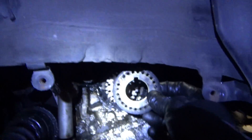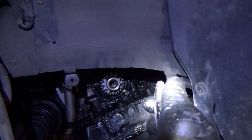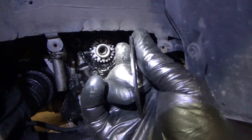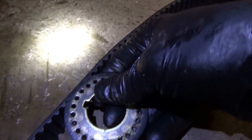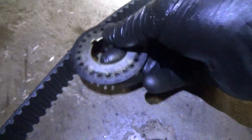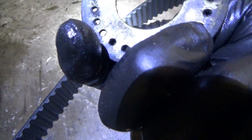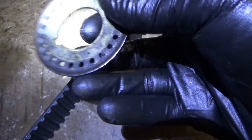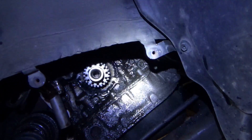This little washer, spacer, belt retainer was installed like this. If you notice, it's not quite symmetrical — there is a concave side and a convex side. Which side do you think the belt likes better? The one angled towards it or the one angled away? This sucker was installed backwards, and the sharp edge was just shaving the edge of the belt away. It should have been installed like this so the belt would be happy. You can see the shiny perimeter — that's where it was rubbing on the belt. That was going on for 100,000 miles. That explains all this debris, and the oil leaks are obviously from the cam seals.